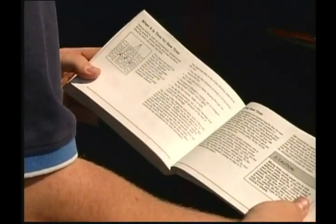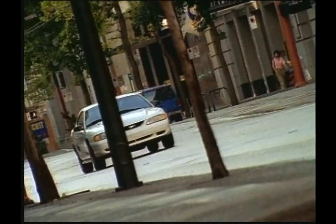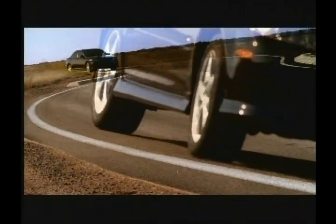For four-wheel drive and all-wheel drive vehicles, even small differences in your tire diameters may cause drivetrain damage or mechanical malfunction. In those cases where you are not willing to replace all four tires at the same time, here are some general guidelines to consider when replacing less than four tires for a vehicle, whether it is one or two tires.